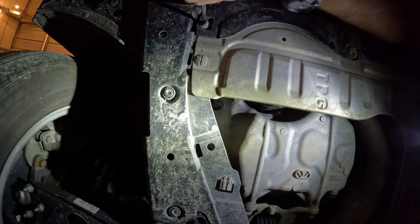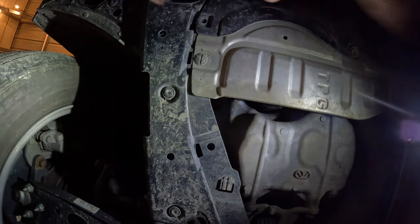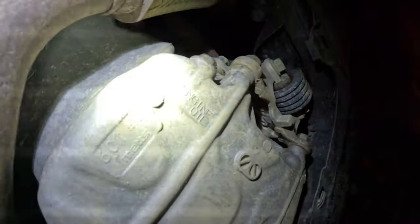So we have a couple of screws to take out. So, there's a screw, and that thing is just like a quarter turn latch. And we need to take this whole section off enough to reach the oil filter, which is up there. And lucky for us, they labeled it engine oil right there, 17 millimeter, which I will notate.